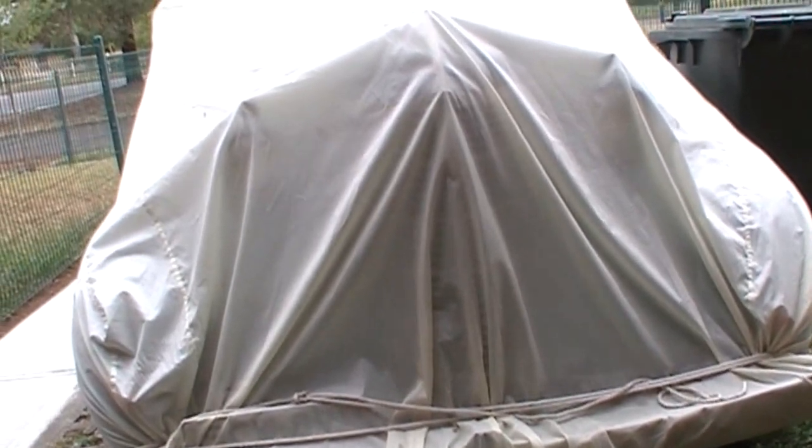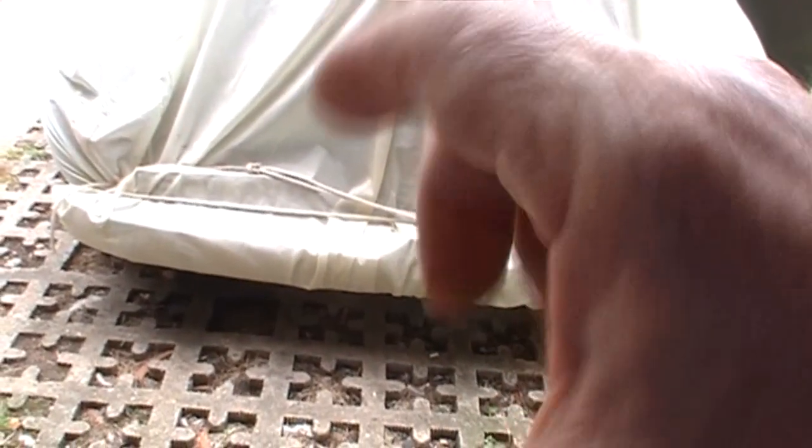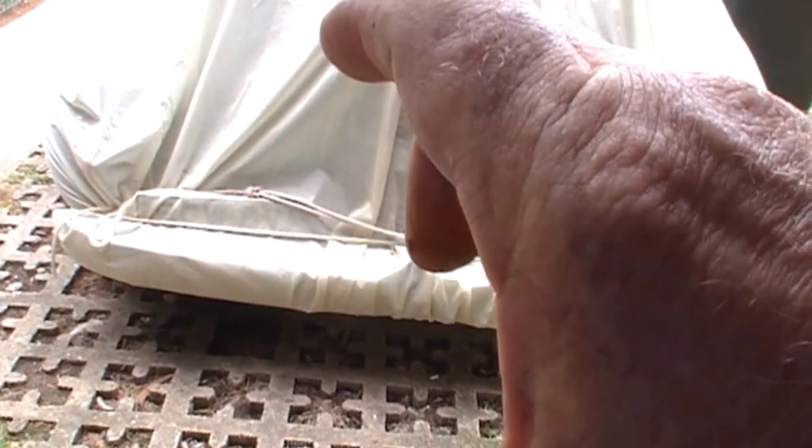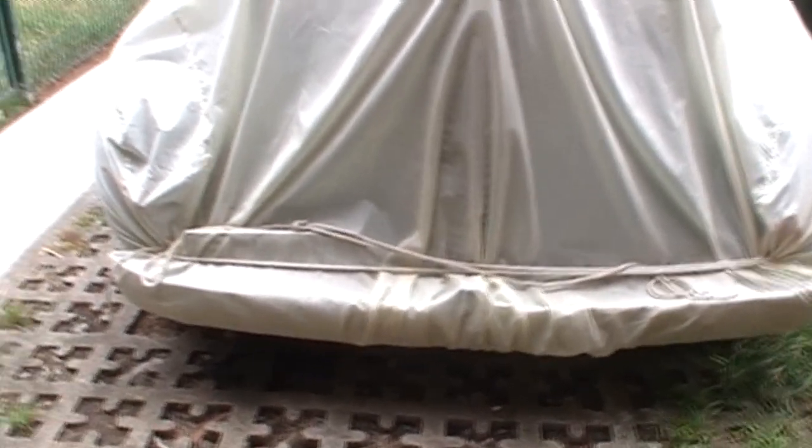One last thing, for me with the temperature sender, I'm in the process of making up a little piece of tube, a couple of inches long, and I'll cut a piece out of the radiator hose and put the tube in. In that tube will be an earth wire, which I will earth, and there will also be a nut, the same thread as what's in that little temperature sender. I screw the sender into my piece of adapter, I suppose you'd almost call it, which will go in the top of the top hose, and hooked up to the gauge. And that's just another little job I've got on the way.